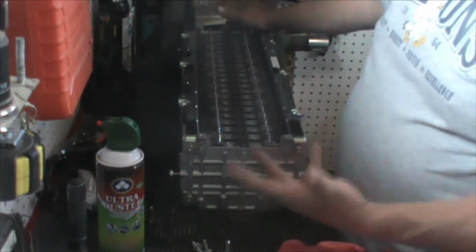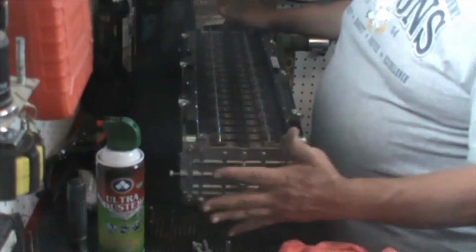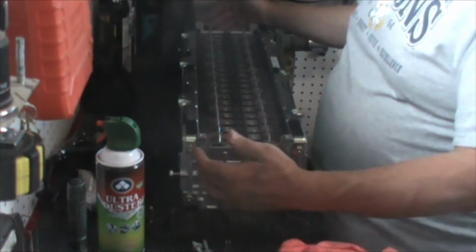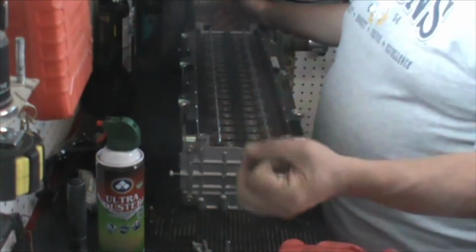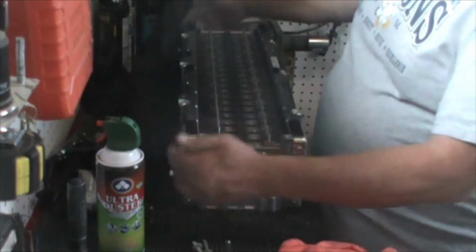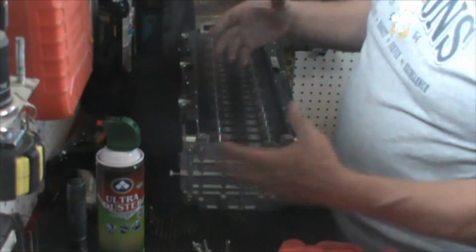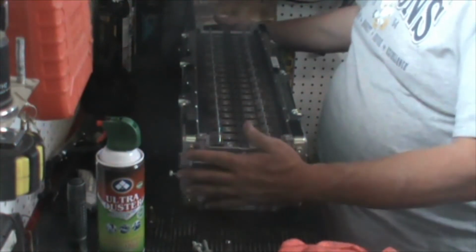So, can you make your own compression system? Absolutely. The best ones are going to be, again, metal end plates, threaded all rod, the big heavy ones. I generally tell people that you want to use a 7/16 or bigger, which is about 10, maybe 11 millimeter. Have at least 4. Some people will do 2, but when you look at it, all of the engineers have always settled on at least 4.